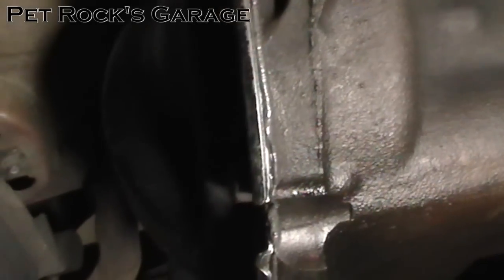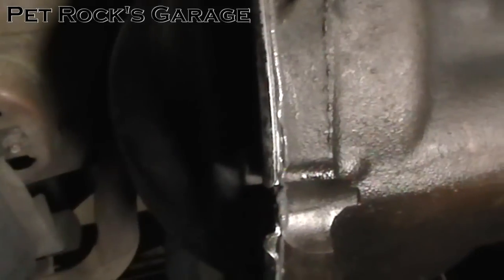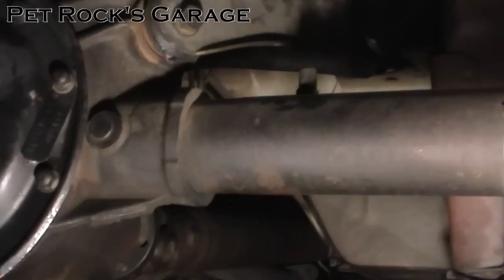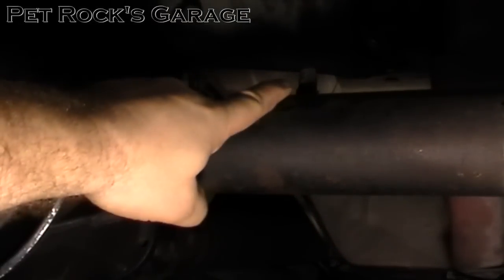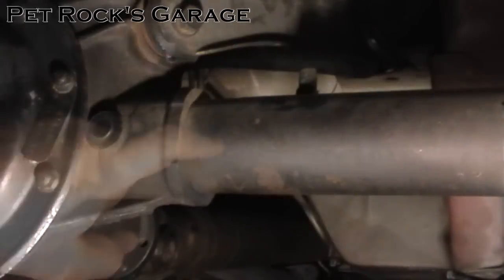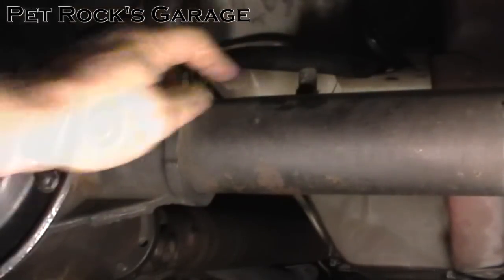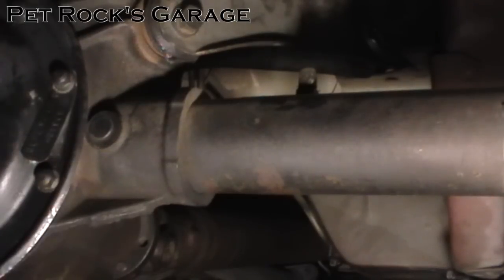According to the RTV instructions, wait about an hour and then come back and tighten each bolt in a star pattern a half to a quarter turn. While you're waiting for the RTV to set, it's a good idea to check the differential vent to make sure it's nice and clear and not clogged with any debris. On this differential it's on the passenger side axle tube. On some differentials there's a hose instead of a little cap like this one has, or the hose may come out of the differential cover itself.